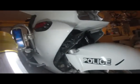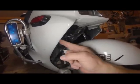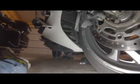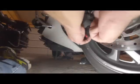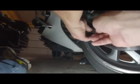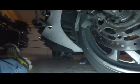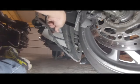On the right hand side, there's a wiring or sensor connector right here. You just undo the Phillips head screw and pull that sensor off. To pull this lower piece off, all you have to do is remove the pin and the Phillips head on either side. Mine's a little bit different because I have extra lights added to the vehicle, which makes it have a lot more wires involved. You just pull your pin, unscrew your Phillips head screw, both sides, and then this piece can come off. Just like that.